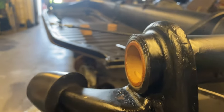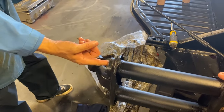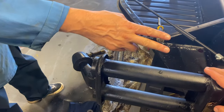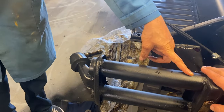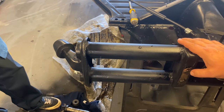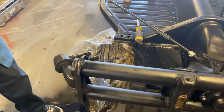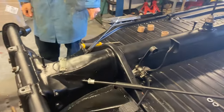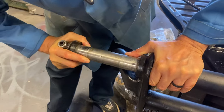If we ream this out if it needs it, we can check for play on that second bush. If that second bush is worn, we'll drive this all the way through, knock in the new bush, measure it, drive that in, and the old bush will be stuck in there obsolete. I've done that before with split bus beams. Anything that doesn't use a needle bearing we just roll through - it'll still be seated, not rattling around loose. Shall we try an arm?